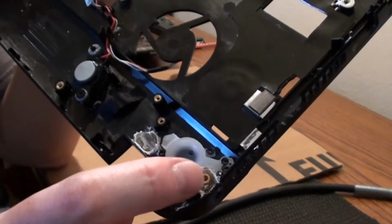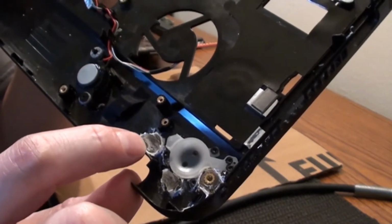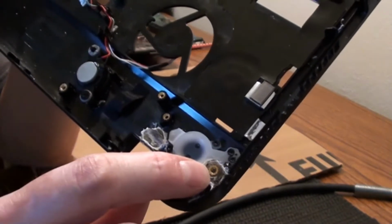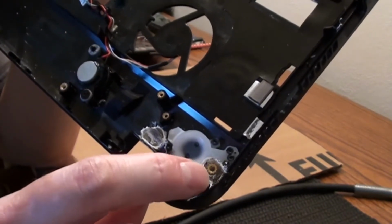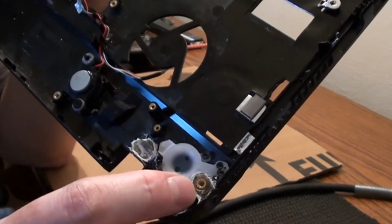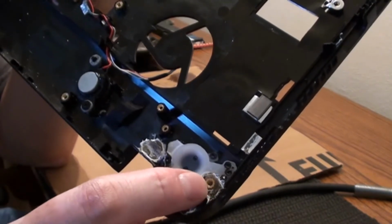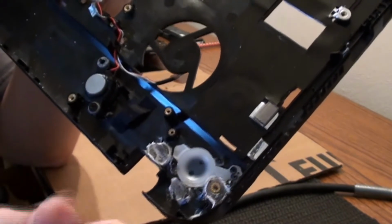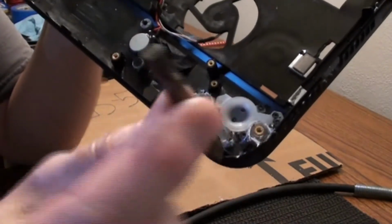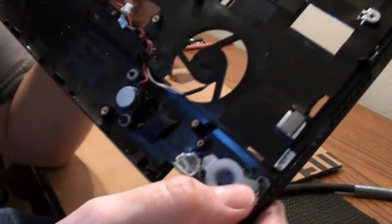This one and this one are my screw points. You can see this first one, I already put the little brass fitting in there with the threads. I drilled the hole the right size first, and then melted it down in there, and then held it down with the drill bit type thing because the epoxy wanted to push it back out, just until it dried.